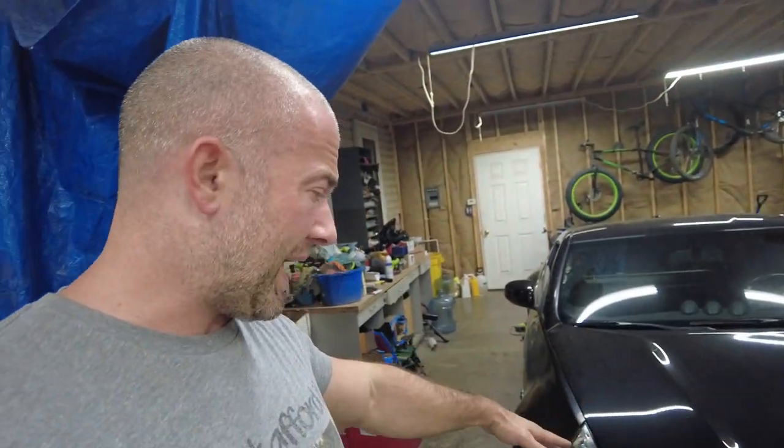There. We fixed the shipping mistake. That tab's not coming off there. I put four metal staples in there, the bigger ones, and then melted plastic over top of all that from the tab off my old headlight. So I used the exact same plastic that came off of this.